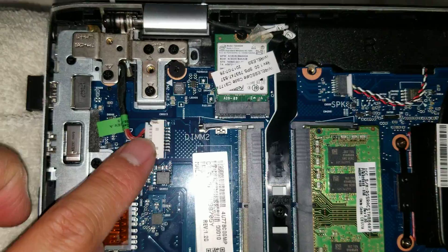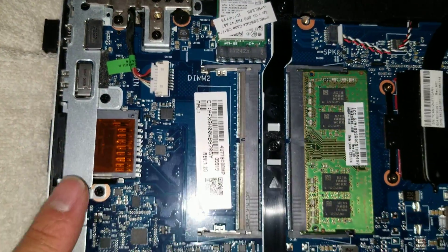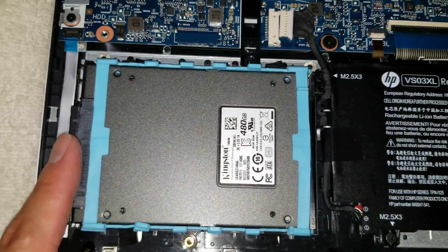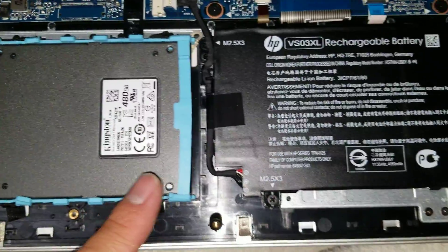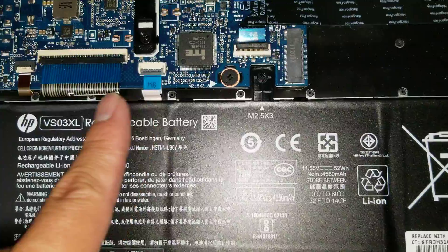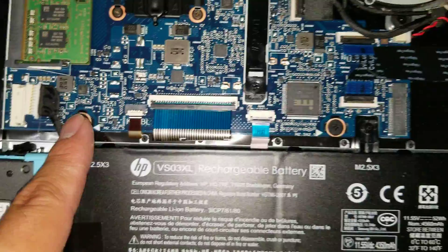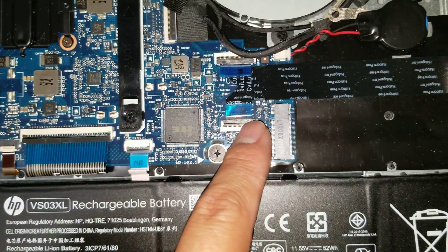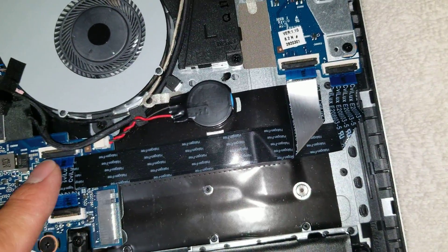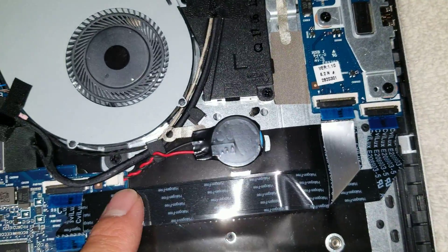You can see the hinge. You see the DC jack here. You've got these little ports and the SD card slot. You've got the hard drive cable — you don't actually need to remove the cable to replace the hard drive, I'll show you that in a bit. Got the battery here. You've got the keyboard connector, trackpad, and this is the keyboard backlight connector. Already unplugged the battery. And then you've got two connectors here — one here and one here — and that goes for this board.